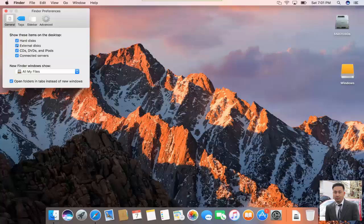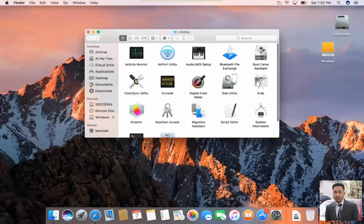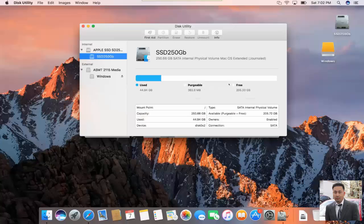What we're going to do next is actually prepare the disk. Right now I can see the hard drive that needs to be cloned. It looks like this hard drive was previously running Windows, so you have to prepare the disk. Click on Go, Utility, and click on Disk Utility. You prepare the disk so it understands the Mac OS format.